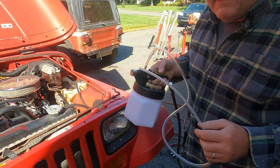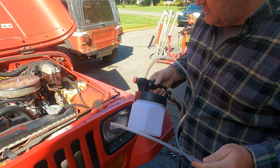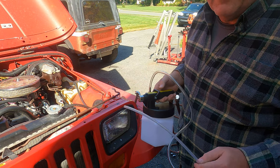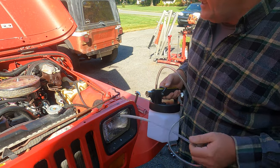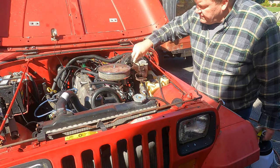So what I have here is a Mityvac. I don't remember the model number of this one particularly. I'll post it in the description below. But this thing's pretty cool, it'll allow you to bleed brakes without having a second person. The first part is, it'll come with the suction tube here, which we're going to draw out the fluid here on the brake reservoir right now. First thing we'll do is take the cap off the reservoir.